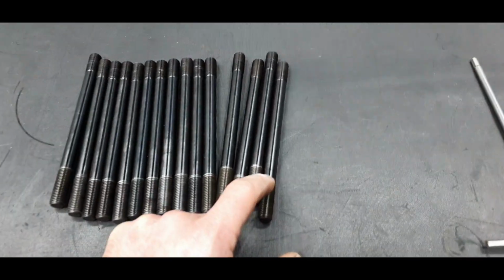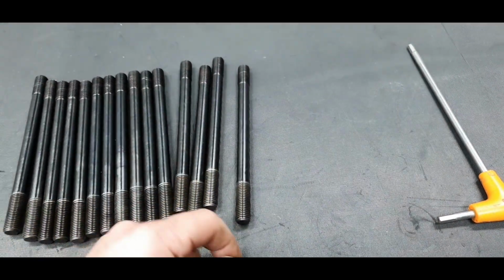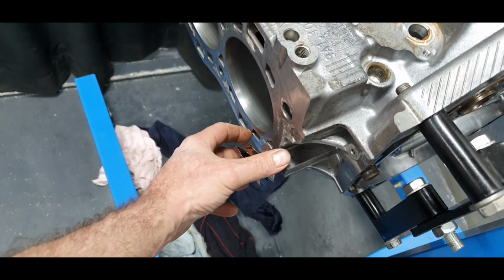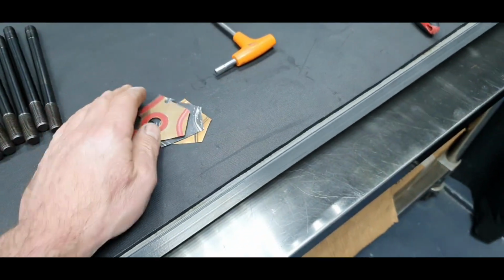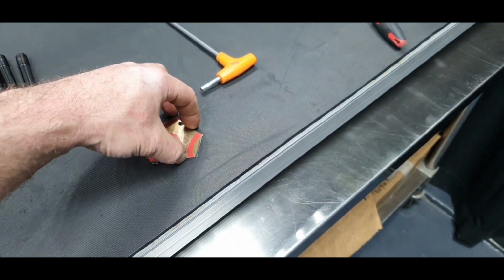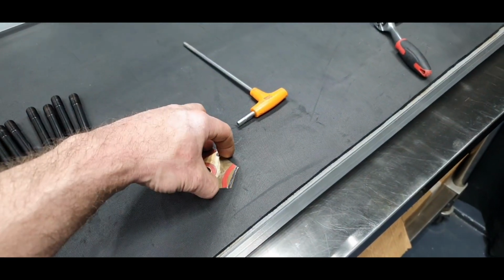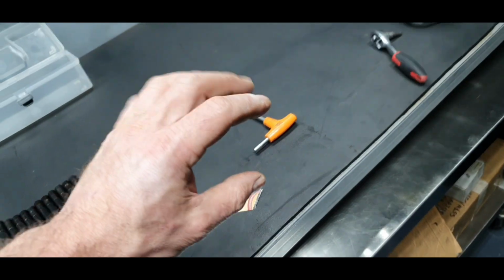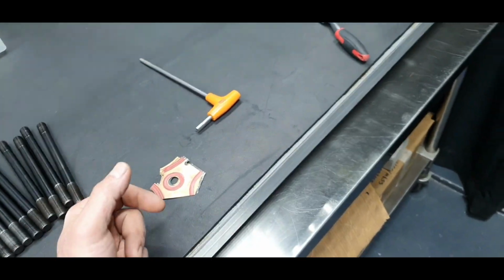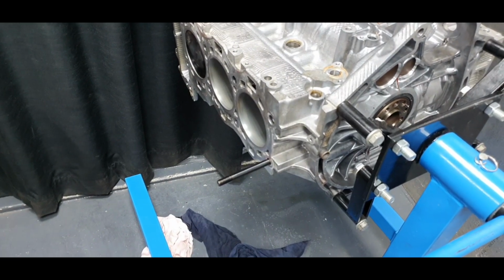That's the reason why I want to drive the stud a little bit more inside of the block. You're going to tell me it's a crushed head gasket, yeah, but it's a metallic head gasket, and even the new one is not, let us say, 2 millimeters, and you are crushing to 0.6 of a millimeter, for example. I'm just saying. Yeah, okay.